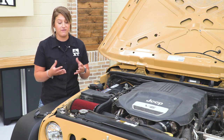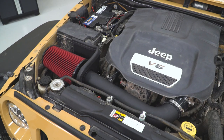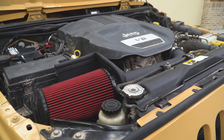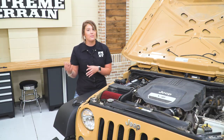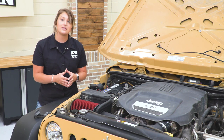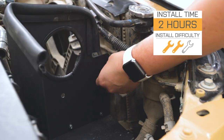But if you are in a drier climate and you're looking for a very easy way to upgrade your intake system, this is a perfect option. This is going to be very affordable at roughly $150. This is an open box option — it only has a partial heat shield. Other more expensive options are usually going to have a full heat shield that will completely protect the filter. They may be closed box options or for snorkel options. Because of the simplicity of the product, that's why it's going to be pretty cost effective. However, that doesn't say anything about the performance — this is definitely gonna get the job done and it's gonna look really good while doing it.